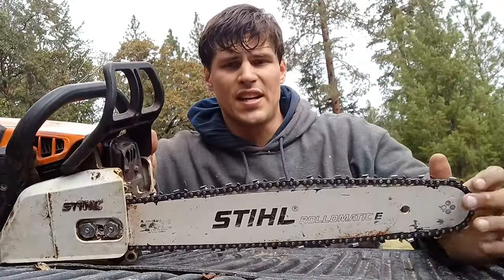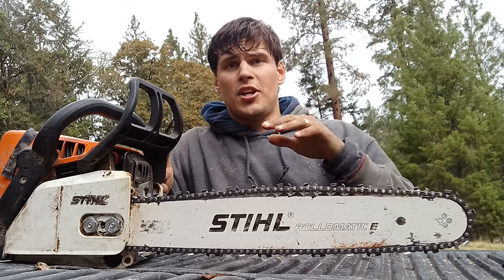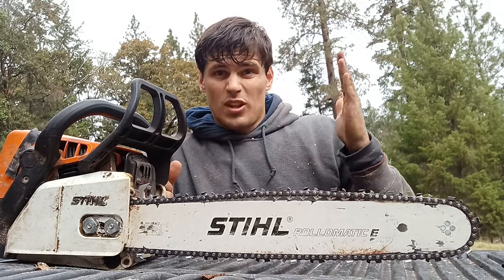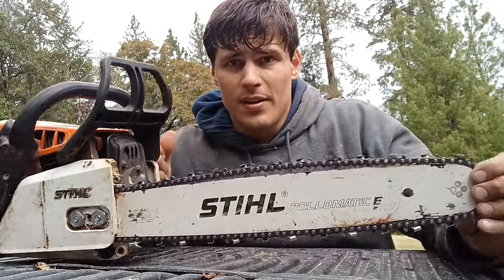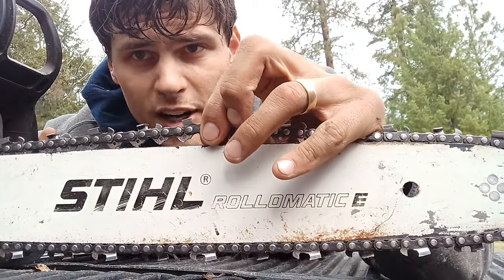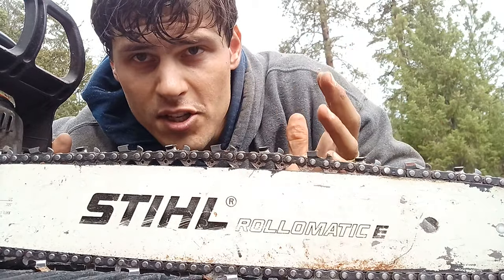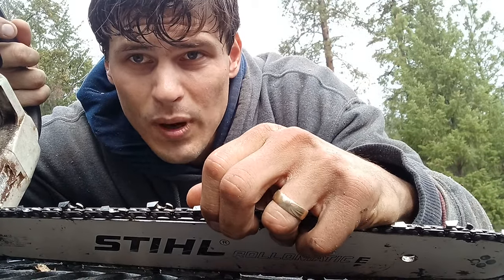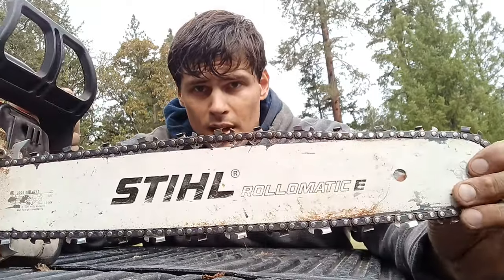Because I didn't have a very good angle to show you what happened to my chain, I'll explain it one more time. In the middle of cutting some wood, my chain fell off — either because I was using too much force, was at a really awkward angle and not being careful, or the chain was too loose. What happened is that at the very top of the chain there are burrs on some of these triangle-looking things, and because of the burrs it won't fit inside that little crevice. I've put the chain back on and tightened it up as best I can.